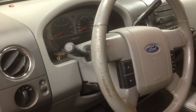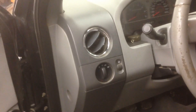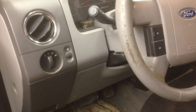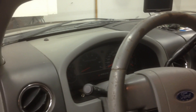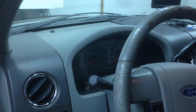What we're going to be looking at here is severe catalytic converter failure on a 2007 Ford F-150, 5.4 Triton V8, and this vehicle has 160,000 miles on it. It was originally brought to me for a misfire, lack of power, and a knocking noise, pinging, coming from the engine.